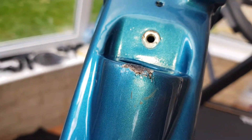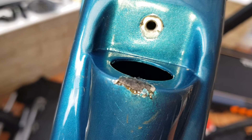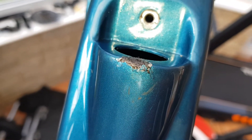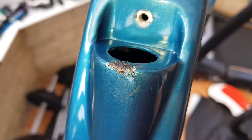So you managed to bash your carbon frame — what can you do if it's relatively non-structural and you're not that bothered about the look? You could try some clear nail varnish. It's not a recommendation by the way, I'm not going to guarantee it. You layer it on bit by bit, let the underneath dry, put some more on. Carbon tends to absorb this stuff if you just put a load on, so you eventually build it up, then sand off the excess — pretty much the same as you would on a set of stanchions on some forks.